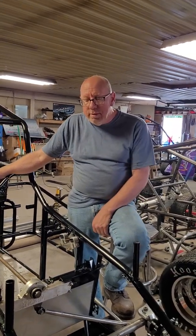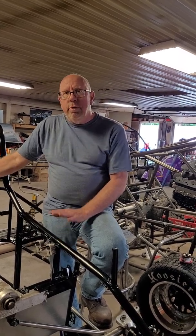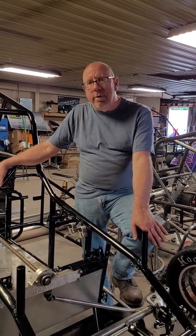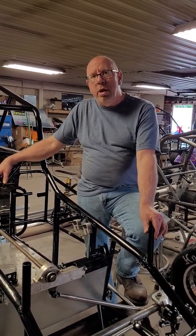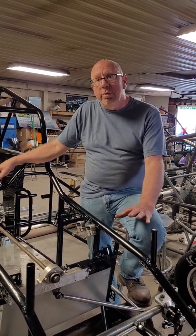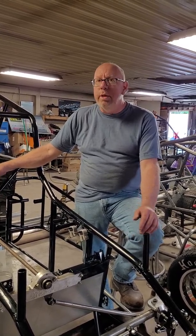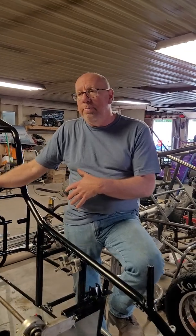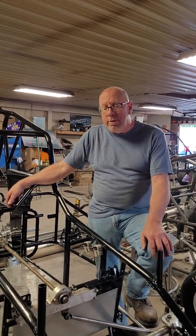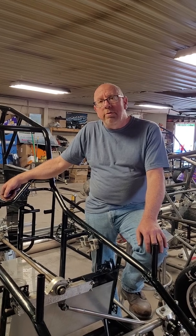The biggest thing is, everybody has a buddy that's in big modifieds. This isn't a big modified. We don't have shocks to play with. Our shocks aren't $1,500 a corner. They're $100 shocks. So you have to play with the parts that you have to play with. You might have to go with different spring combinations to make the shocks do different things. That's why we go down the paths that we go for setups. It might seem unorthodox, but sometimes that's what you have to do to make stuff go.